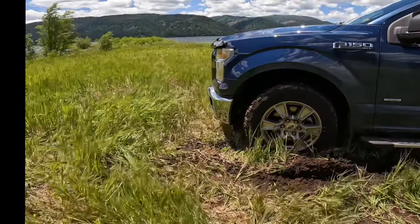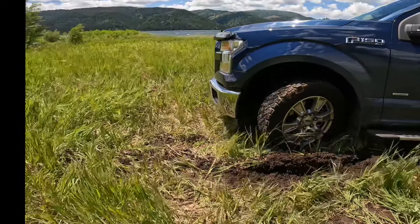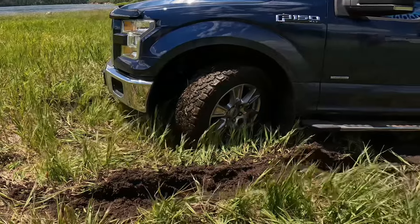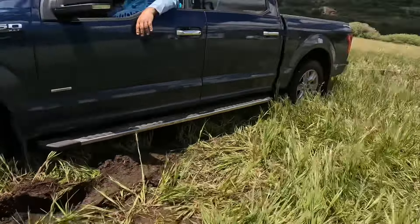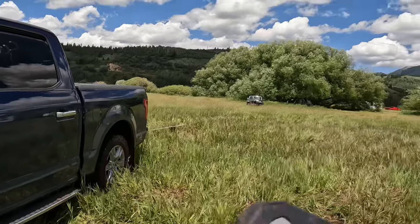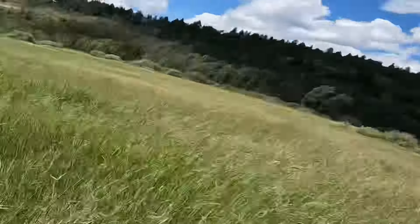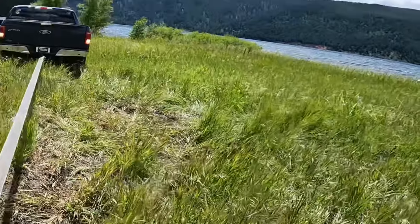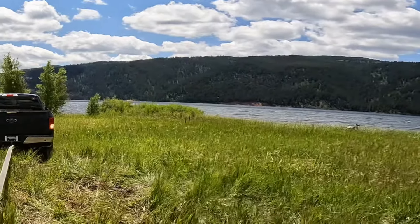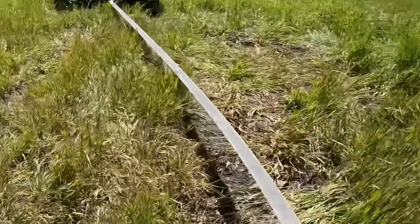Go ahead and turn more towards the driver's side. Start to line up with my truck. Very nice. I'm going to grab the strap and flag you back — just back up to the driver's side of my truck and don't run the strap over. Come on back. Once it starts to go, go for it. So because it's two-wheel drive it just wants to spin, so we're going to go ahead and get rid of the snatch block now that we're out of the harder pull zone and just pull it on back.